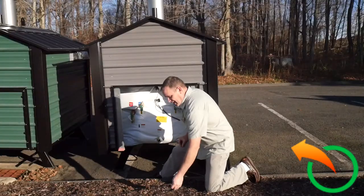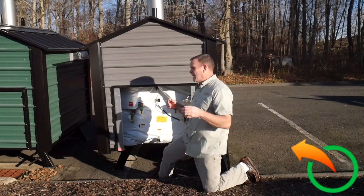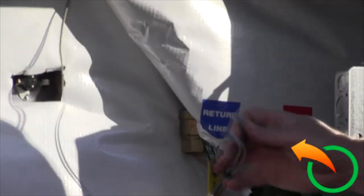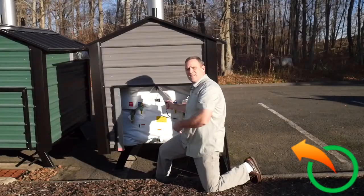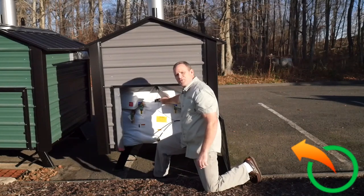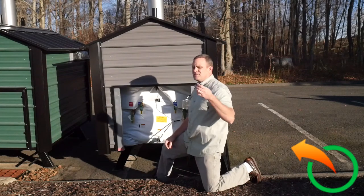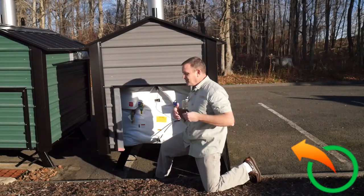Make sure you've got a good connection and that the spade connectors are on nice and solid. If you want to test to see if the snap disc is any good and that's what's causing your problem, simply pull off both spade connectors, put a wire in between them, and jump it out. That will activate the fan if the snap disc is the problem. To replace the snap disc, it's only a couple of screws — unscrew it, get your new snap disc. Very inexpensive, under $15. Reattach, replug it in, and you're back up and running.